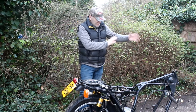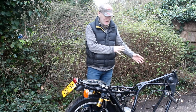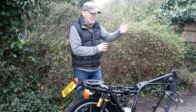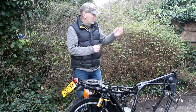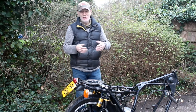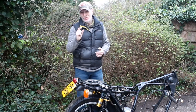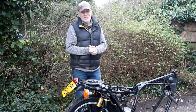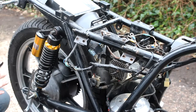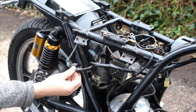The front end of this bike is amazingly heavy - I'm surprised how heavy the mag wheel was and how heavy the 37mm forks were, certainly heavier than the 43mm forks my Moto Guzzi has. The reason, of course, is that back in the 70s they over-engineered everything. The wall thickness of the stanchions is massive compared to modern forks. Whether that's a good thing or a bad thing is another matter, but they are bloody heavy. The first job now is to remove the wiring harness - and as you can see, it's a bit of a mess, a real mess.